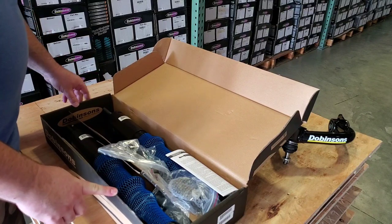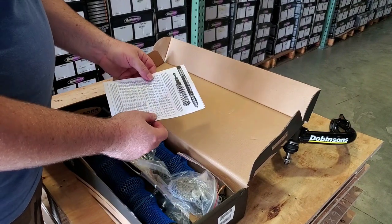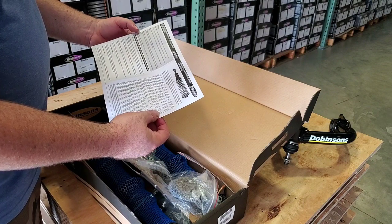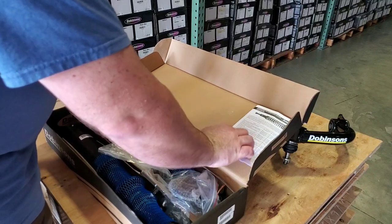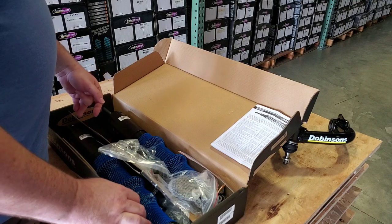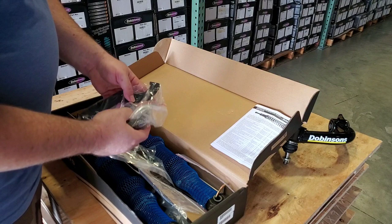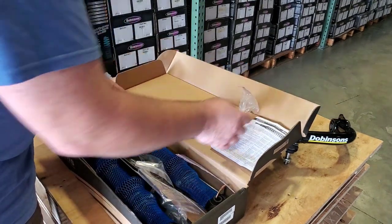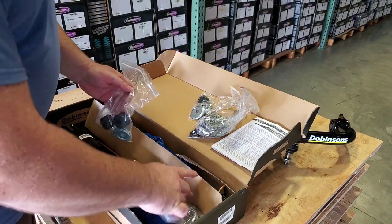This is how they come as soon as you get them from the box. We're going to have a look at what's inside, some basic information, how to set the coil seat height — I'm going to need a tape measure for that. I'm doing it here on the IMS because it's a little bit handier to show you than the MRA — the MRA is Monotube Remote Adjustable — and those have a big hose and reservoir. So I'm going to show you: we've got a coil seat and adjuster, top mounts and bushings, and the same for the other side.